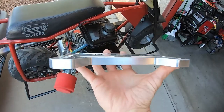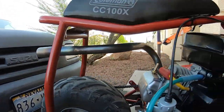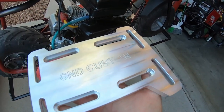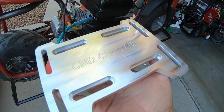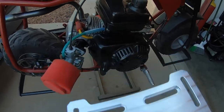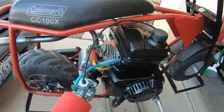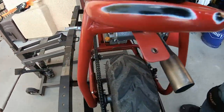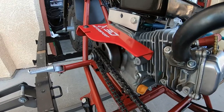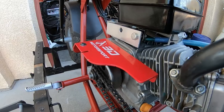What's cool about it is it doesn't raise the engine much — only like a half inch — so the pipe will still clear everything. With this mount I can slide the engine back and forth, side to side wherever I want without raising the engine too much. This is an easy way to get the engine more towards the center or wherever I want it, so whatever sprocket or clutch configuration I choose, I can move the engine to accommodate it.